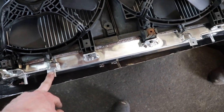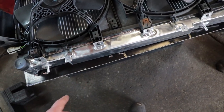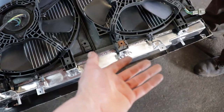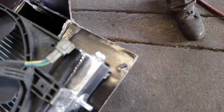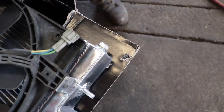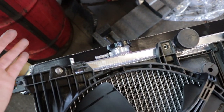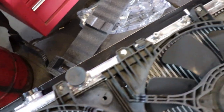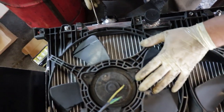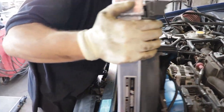Note that this radiator does not come with a cooler for your transmission, so you need to specify whether you have an automatic or manual when ordering. If you have an automatic, you will not have your trans cooler on this one. Also make sure the plugs — especially the drain plug — are tight, and make sure the stem is tight as well, because these may not be tight from the factory. If you don't test that, you may have a leak later.